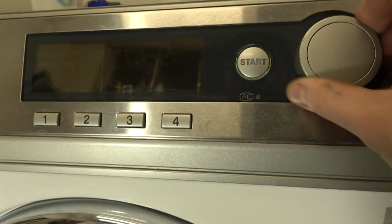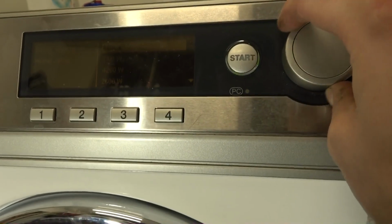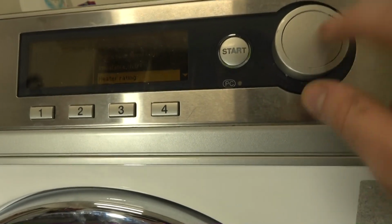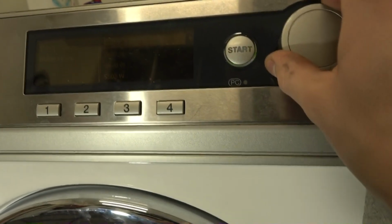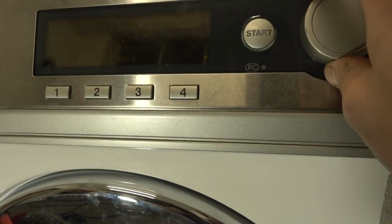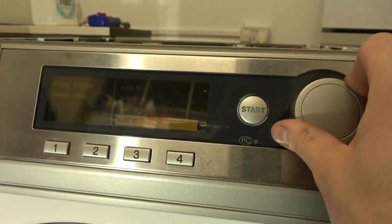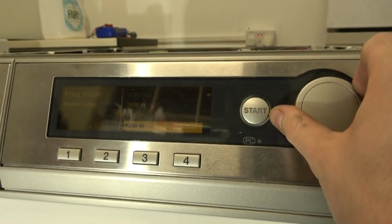Heater rating, it's set to 5300 watts, but now we've only got 2600 watts because we've cut down to half. So we're going to select that now. It looks like you can't have 2,000 watts. 2,600 times 2 is 5,200 watts. So it looks like you can have 2,100 watts, 2,600 watts, a 3,000 single wattage, a 4,700 which would be the 2,100 and 2,600 added together, and a 5,300 watt.